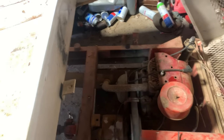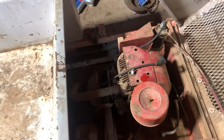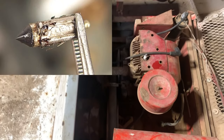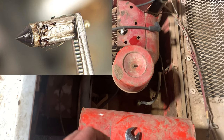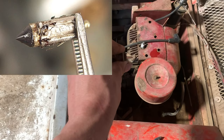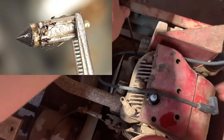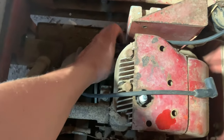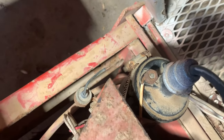Most people don't think of it, but drain your gas tank when you park something, because all this stuff inside here accumulates over time. Got a crankcase full of old gas — we're going to have to clean that out. Someone's been after the wiring in it, and that's not even the right size wire.